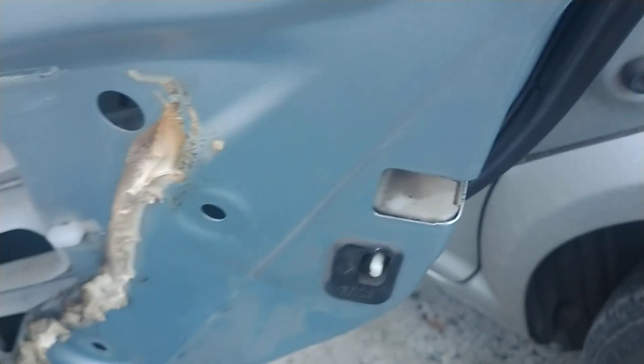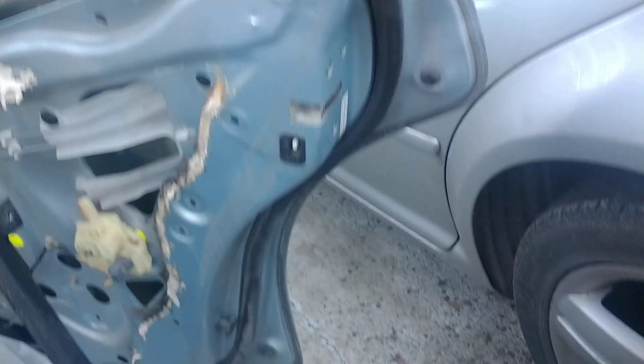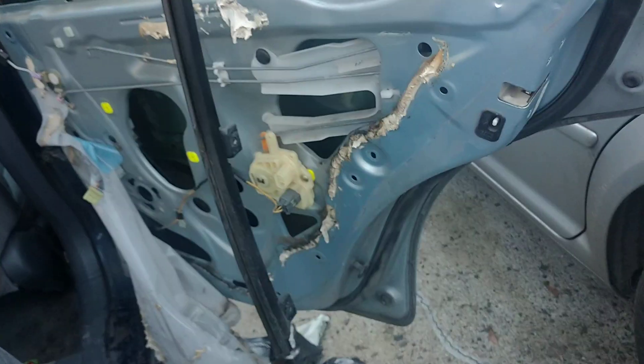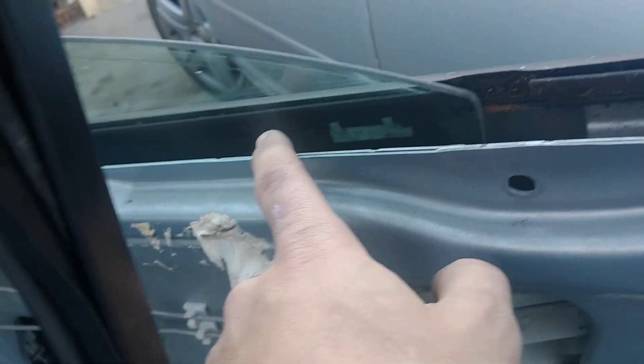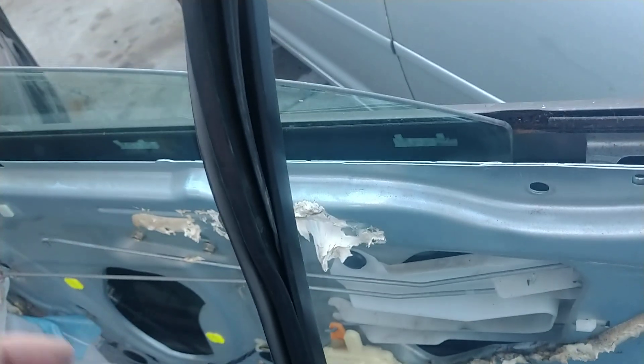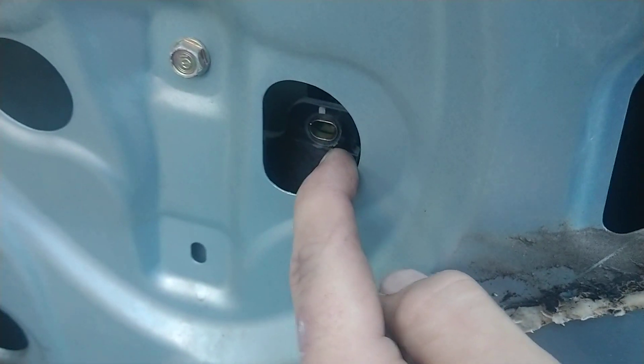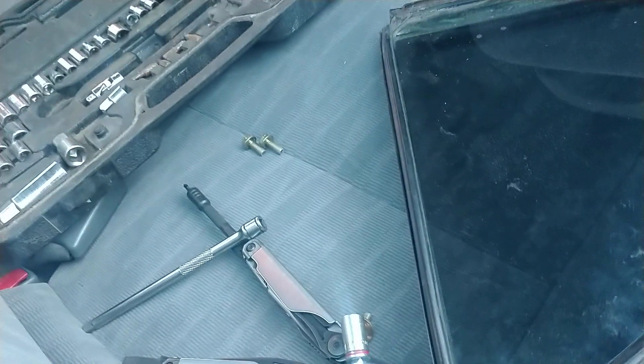You want to avoid scratching any paint, but if all you've got is a flathead screwdriver, that's what you've got. Once it's popped free, it just lifts up off of the door. A little trim piece will sit in here — bend it back and lift it up off. Once the panel is off, with the window down, come through these holes: there's going to be a bolt in this hole and a bolt in that hole — they are the little golden ones.